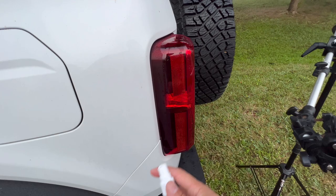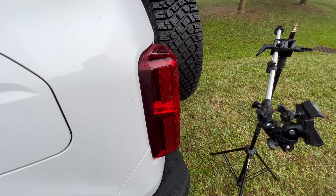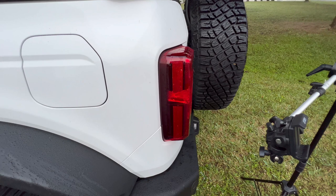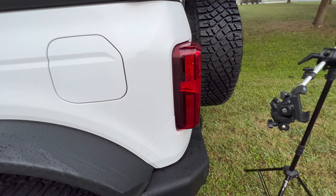If you don't have a squeegee, I recommend that you get one. You can use your fingers on this. The only other thing I'd recommend keeping around is a heat source, especially if you're doing this out in the cold — you have to get everything up to temp. Ideally, you'll be 70 to 80 degrees when you apply this. It's right at 70 degrees in North Fort Myers right now, even in December.